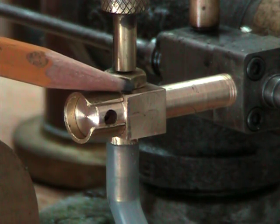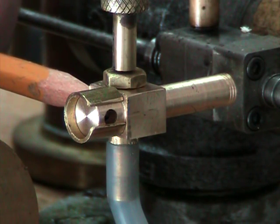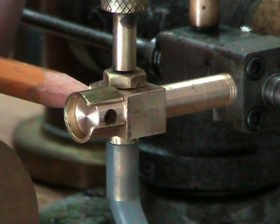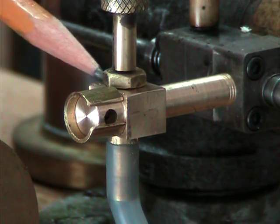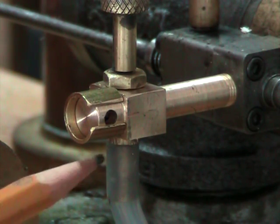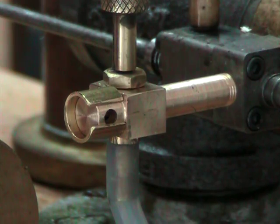Opposite and slightly below that hole that goes into the venturi is another very small hole — I think it's a 45-thousandths hole — that comes in the back and goes all the way through into the fuel chamber right next to the needle valve, right after the fuel shut-off part of the needle valve. This allows air in from this side to mix with the fuel before it goes out into the venturi. By turning this whole needle fuel jet assembly with a pair of pliers using the ring on the bottom, I can adjust the amount of air admitted through that hole in the back into the premix chamber, which helps to vaporize the fuel.